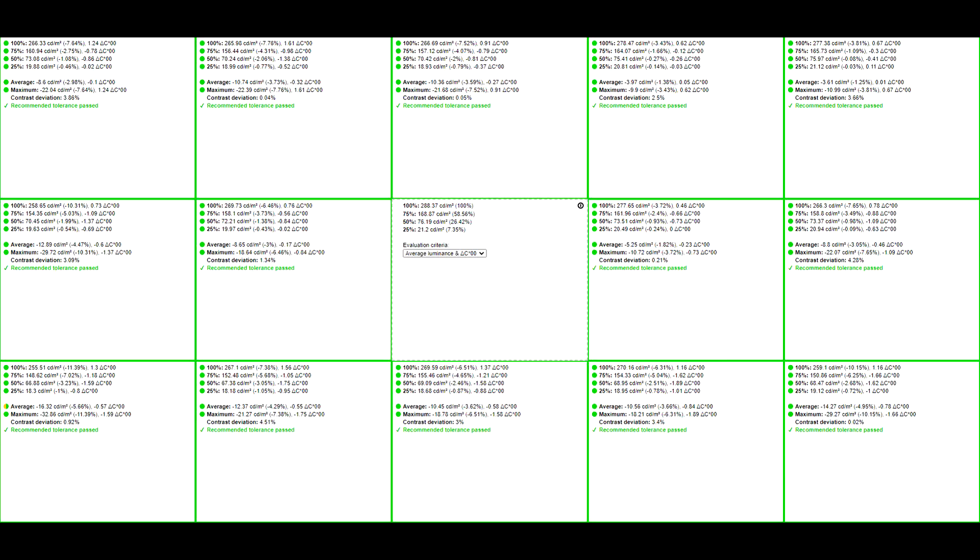On the plus side, this monitor has great brightness uniformity — given it's a TN panel, that's no great surprise, but it's great to see such results as you can see on screen right now. You can see a slight colour shift when turning from left to right, and this is the disadvantage of a TN panel over VA or IPS, because viewing angles aren't amazing. Although in this day and age they're pretty acceptable, and compared to TN panels from ten years ago it's a night and day difference.